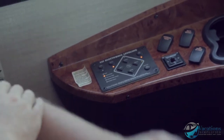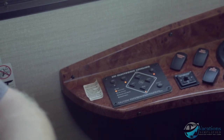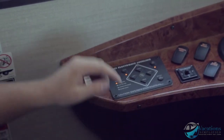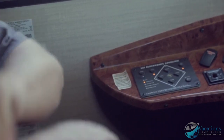It lets you know which side it's working on, then does the rear. Once it's all level, LCI will light up. The process can take a couple of minutes, and you'll hear popping sounds — especially if the slide rooms are out, as it's tweaking the frame. I like to level with the rooms in first, then extend the rooms, because leveling with rooms out causes more popping since the rooms push on the walls.